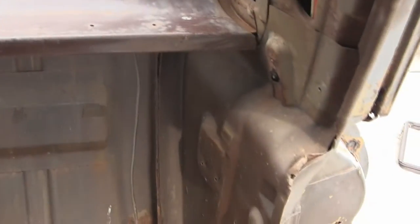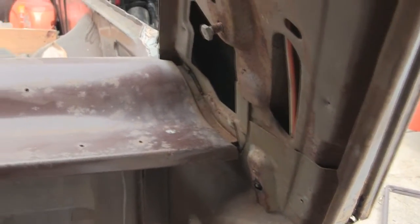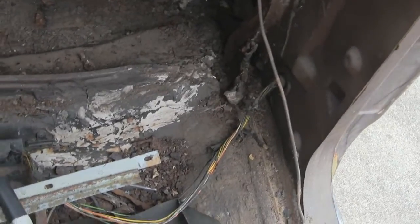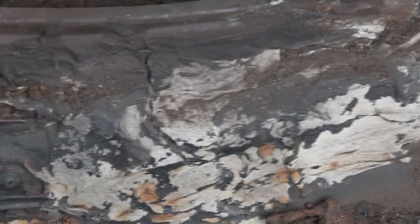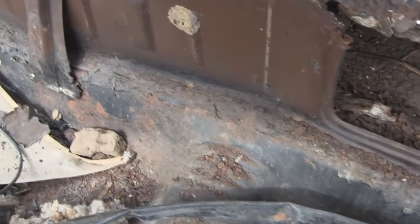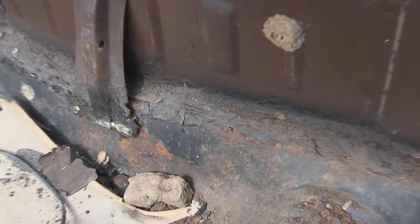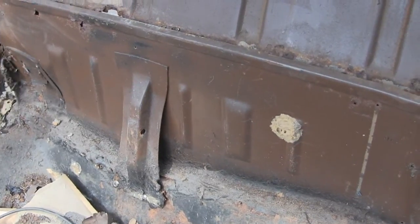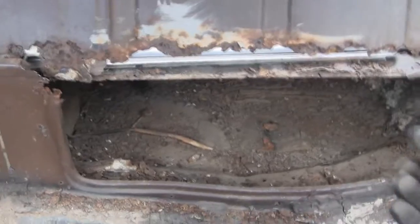If anybody's going to be buying an El Camino, pay close attention — they're all rusting out in the same areas. If you get an opportunity to look at some things, you'll have an idea of what you're going to be up against. When this car was redone way back whenever, it was painted brown over the gold. They just slathered what looks like seam sealer — could be Bondo — it was actually rusted out all the way across the whole lower section. You can see where they put tar all the way down. There's the spare tire and jack, and maybe that's just a storage box — they call it a smuggler's box.